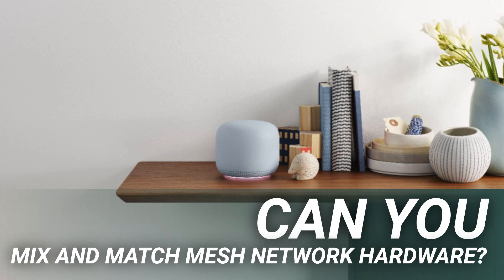Between the different mesh standards and the nearly non-existent EasyMesh support, you can't just hook up some Google Nest Wi-Fi nodes to your existing Eero system or throw some inexpensive TP-Link Deco units in somewhere to boost coverage. At best, if the manufacturer supported it, you could turn the new mesh nodes into just dumb access points, tethered via an Ethernet backhaul back to the existing mesh router. For example, you could keep the original mesh router in place for its parental controls or bedtime lockout features while using the newer mesh nodes as access points to handle the Wi-Fi.